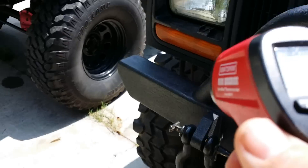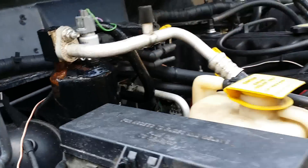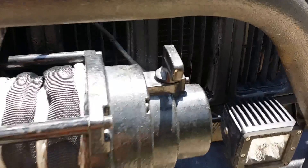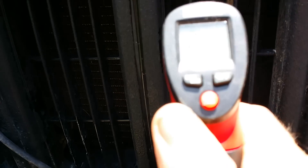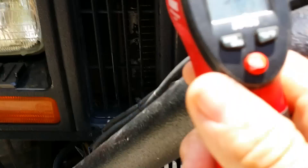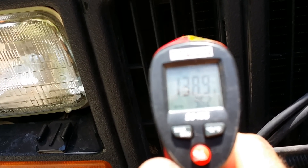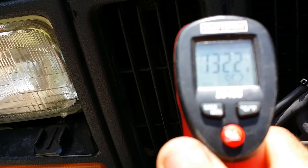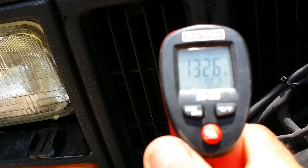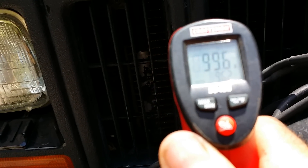My AC's been running, it's bright out here, you can see it sweating - it's been running. That condenser in front of your radiator there, let me shoot that thing. See, it's 114 degrees. See what it is on this side - that condenser is 132-133 degrees. So you're pulling 133 degree air through that to your radiator.